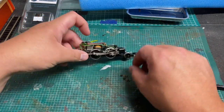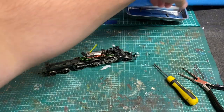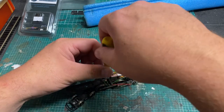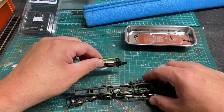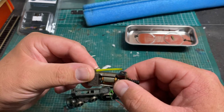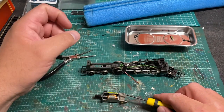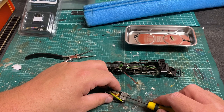I'm now disassembling the motor by removing the spring brushes. The brushes seem to be in good condition — they've got some wear on them but not too much and should clean up quite nicely. To release the motor from the chassis you undo a small flat-headed screw at the back of the motor and then it comes out from its fixing lugs and lifts away. Now the motor has been removed we'll have a look at the armature — apart from needing a good clean it looks to be in good condition. Testing the magnet with a screwdriver proves my theory that the magnetism has gone.